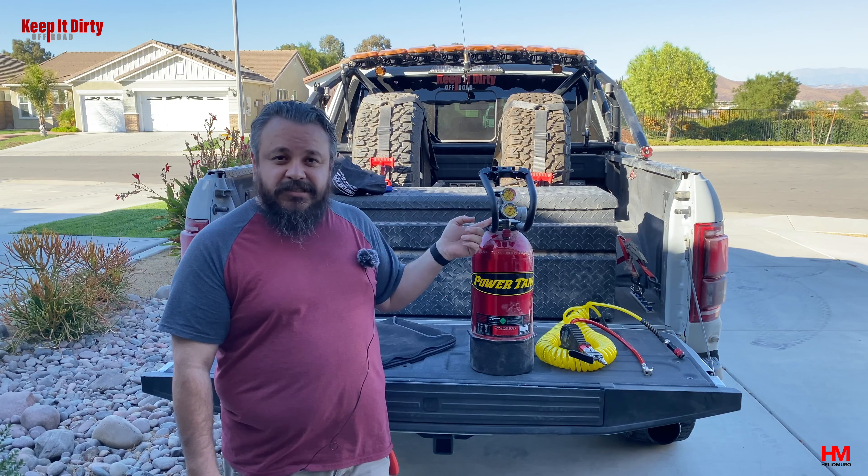I think this is the first time it's been filled. Would you mind putting the actual empty weight once you guys have it? So what we do now is we go and vent it, because the way CO2 is filled is by weight. If you don't start with a tare bottle, you don't know exactly how much you're putting in. So this one was completely empty — we know it's at its tare weight. Tare weight: 7.8 with everything else on it. Then we attach the fill hose to it. Make sure it's open — kind of like filling a propane tank.